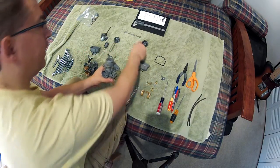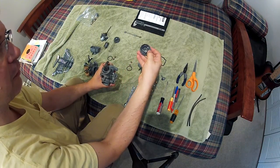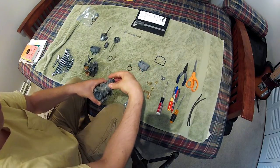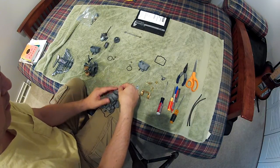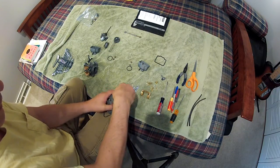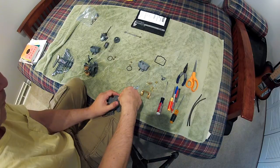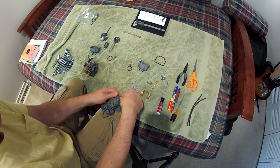With the slide in, we can put the spring in. There is a brand new little gasket that goes in the top of the cap, and that fits to the spring and then assembles onto the top of the carb. I'll need to take this off again when I get it on the bike to set the cable, but I'm doing this now so I don't lose those parts and keep them together with the carb they're supposed to go to.